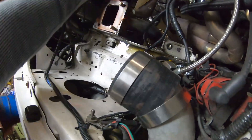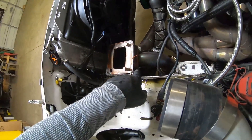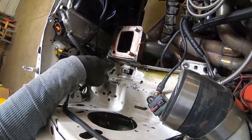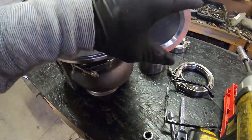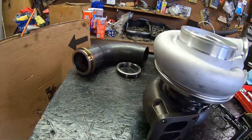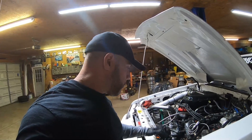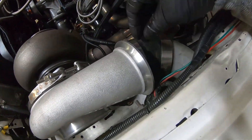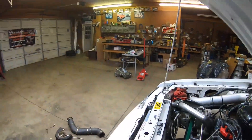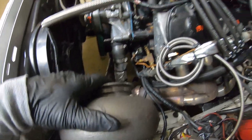I actually have a mount that I had to create because the old turbo kit installed on the 363 many years ago with Big Dog had different motor mounts - it moved it like an inch and a half, two inches. So we made a plate here to help support it. We're going to start test fitting where this goes. We'd have to make an adapter for the downpipe and an adapter for the exit of the turbo because we're not going to be cutting anything as of right now. We might even run with no hood. We have to clearance the inner fender just a little bit and modify our inlet tube with the V-band, making a four inch to three and a half inch adapter to see if we can reuse our downpipe.